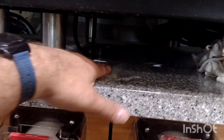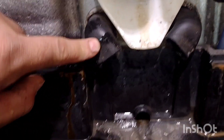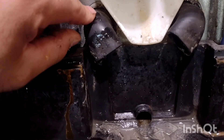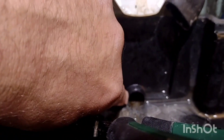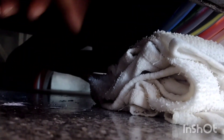Today we've got water underneath the fountain. There's a couple of reasons this can happen. Sometimes it's these ice bin drainages — if there's a backup in there, water will find a way out somewhere else. Sometimes it's the drain pan drainage; if any of that drain gets backed up, sometimes it'll form condensation and start dripping.